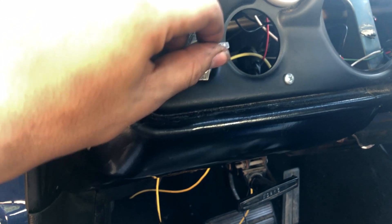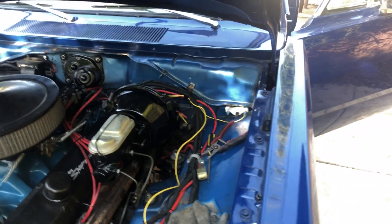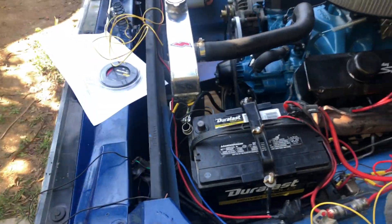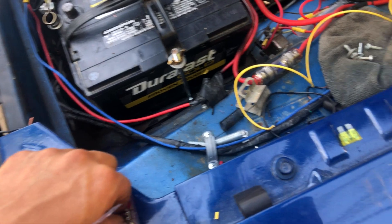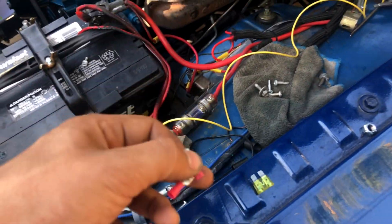Now it's time to connect everything. The last step for all of this to work is connecting this wire to the battery — it's the wire that goes to the middle of the switch. Before we plug that in we have to put a fuse in it. I actually don't have a fuse holder on me right now — I am gonna get one later. For the sake of finishing this video, I'm basically gonna get that fuse, put two disconnects on each end of it, splice the wire in half, and connect each end to each quick disconnect.